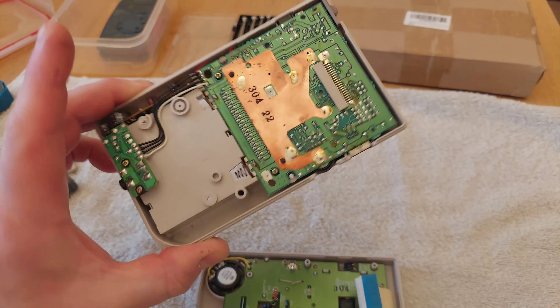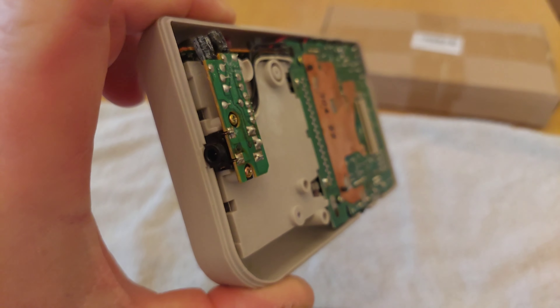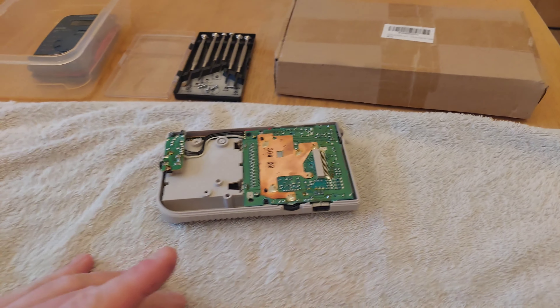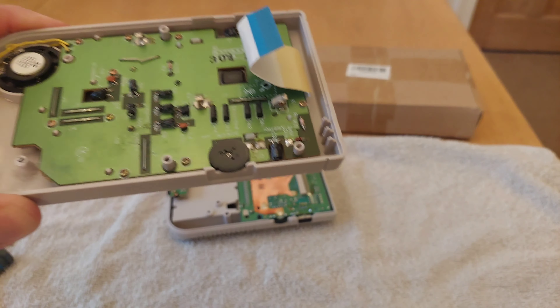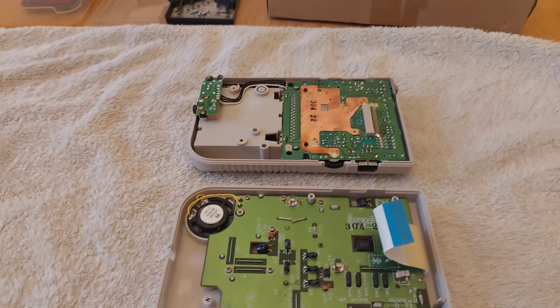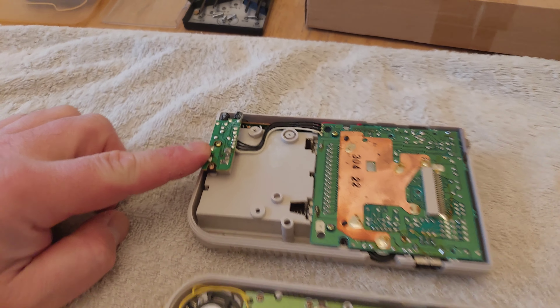You can see the ribbon that I had to disconnect from that connector to separate the two sides. This side is your battery compartment, and you've got the earphone circuit board at the bottom with all the connectors attached. On this side, which is the screen side, you've got the volume control and then you've got the internal speaker. There are a few things you can do to test whether it's the speaker at fault or the connector inside the earphone socket.